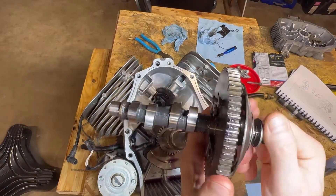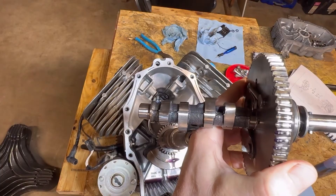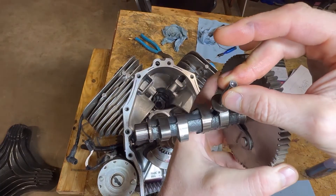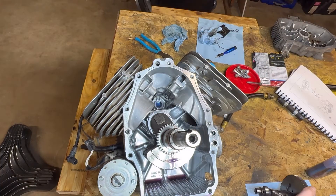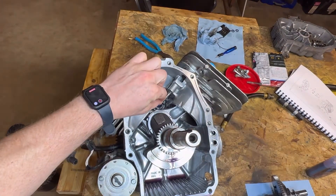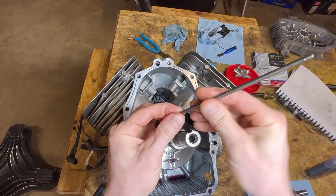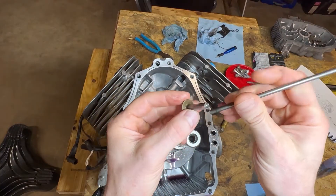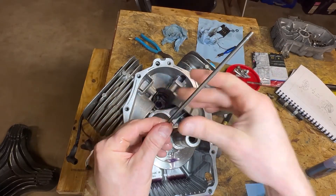Look at that — a little short guy. As this turns, it is timed to the crankshaft to turn these lobes up and down at a very specific point. These lobes push up and down your lifter, going up and down at a very specific time. These lifters slide in right above your camshaft. As they go up and down, what is the lifter lifting? It's lifting your push rod. This here is your push rod — it's got a little cup at the end of your lifter right there. This push rod pushes up and down, right on your camshaft, which rides on your crankshaft timing.